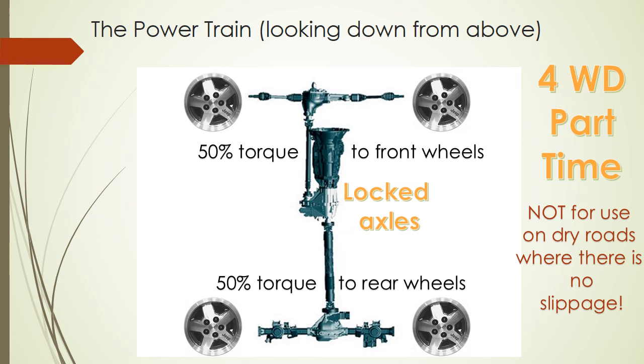When turning, inner wheels traverse a smaller arc while outer wheels must spin faster to cover a wider arc — the difference is slippage. Your wheels need to spin at different speeds, which you won't get in part-time mode. What you feel in the steering wheel is the tension and extra strain on the drivetrain. It's not unusual to experience wheel skipping, where you're actually dragging your tire across the pavement and hearing your rubber screech and squeal. The engine power pushes the Jeep and drags the tire because the wheels cannot slip out of sync. Great setting for four-wheeling, not for paved surfaces.